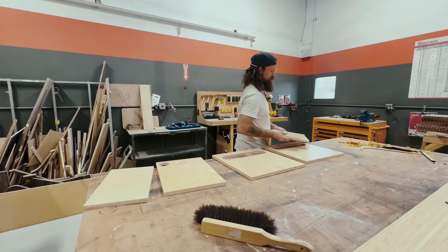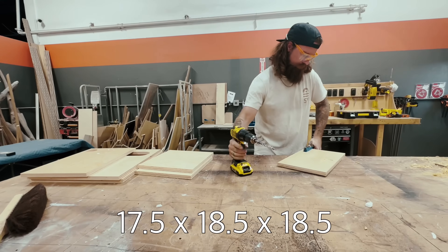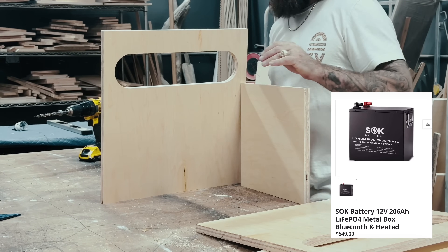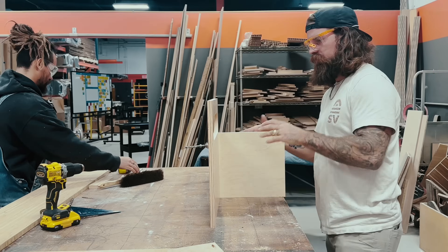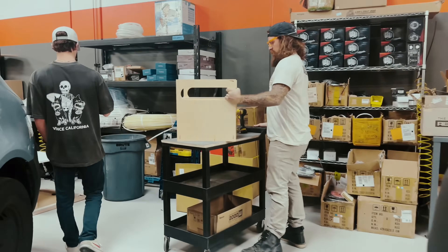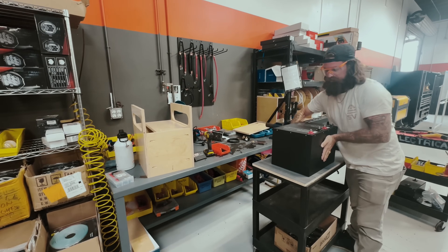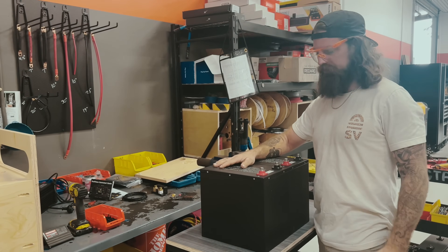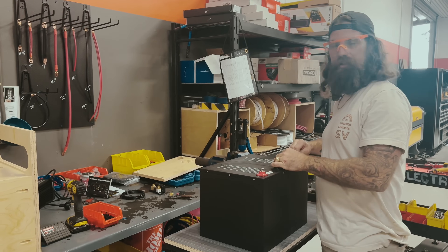Next is the creation of Sandy Van's custom wooden storage box. The box is 17.5 by 18.5 by 18.5 inches, which is perfect to fit my two 206-amp-hour SOK lithium batteries. The only thing on the outside of that box extending past that is your wire runs and the Manager Alpha, which depends on the size you choose, so that can vary pretty significantly. For this electrical system we use SOK batteries, which have over-temp protection, under-temp protection, and internal heaters — so these batteries are pretty great.